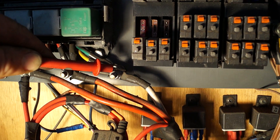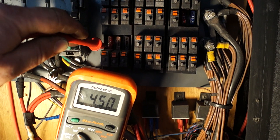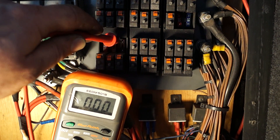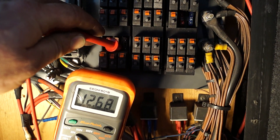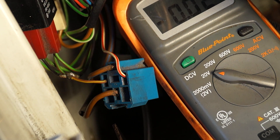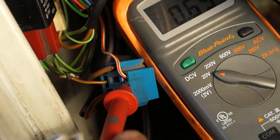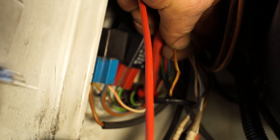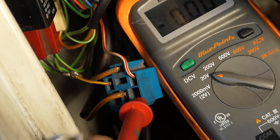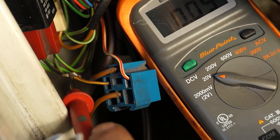It gets complicated, but as long as you understand vehicle wiring you can get around these things. It's something to consider because you could have an immobilizer in a vehicle that is cutting the power to your starter. These fuses are all vehicle-related and these are a backup system — originally it would have cut out if there was a problem with charging. Also to consider, especially with starters, you'll notice there's a brown with a yellow tracer and there is no black wire in the relay plug. The wire has been cut and bodged in, because this was a V8 and it would have had a park relay sensor to stop you starting if the vehicle wasn't in park. So if you do not have a black wire on the other side of your switching, that means there is another relay in line somewhere.